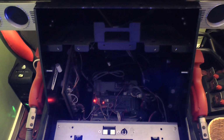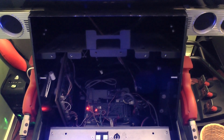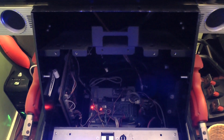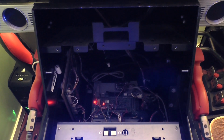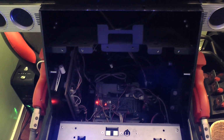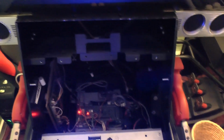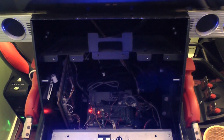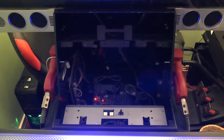So whether it's yellow or red, or I think blue as well, there are different types of Lindbergh main boards that you can buy. It's a PC based system that would connect to a PC via a JVS compatible USB port. Well, my PC that I'm using here to do emulation hasn't got that capability. So that JVS pack enables me to connect the JVS harness, and it converts it effectively to USB, so I can then connect that to my PC.